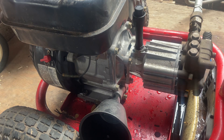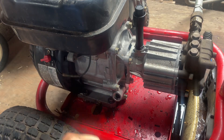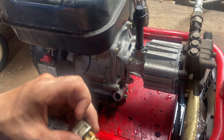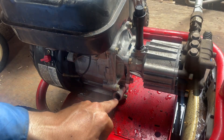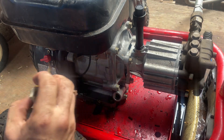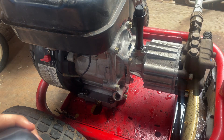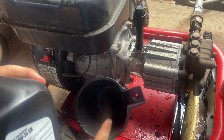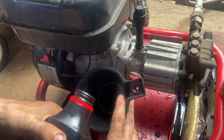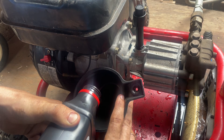It's a little tricky to put the oil in there, but it's about 20 ounces. You want to go to the bottom of the threads basically. Even on this dipstick, you want it all the way up, but the dipstick doesn't even matter where you're supposed to have it — right down at the bottom of the threads — that's how these little horizontal engines work. There are a lot of different places these engines are used, not just these little Subaru EX21s. I'm using some 10W30 here.